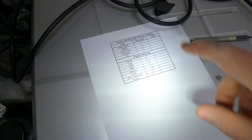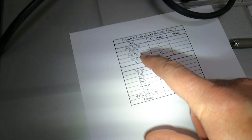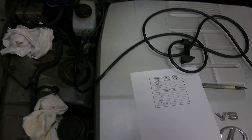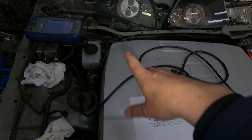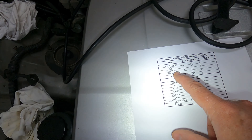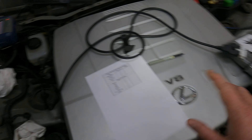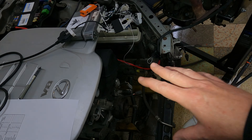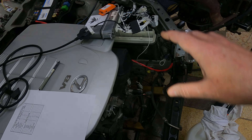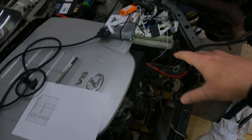So, what are we going to be testing today? First of all, we're going to go through all the stuff inside the vehicle with just the ignition on: make sure all the dash lights work - check engine light, oil lights, battery lights, all communicating from the ECU. We're going to make sure the OBD2 works and see all the live data. We're going to check the fuel pump works. Our little device does actually prime the fuel pump - which is not a standard Toyota thing. Toyota pumps do not prime if they're wired properly and working through the ECU.